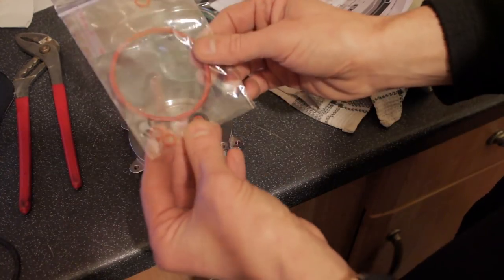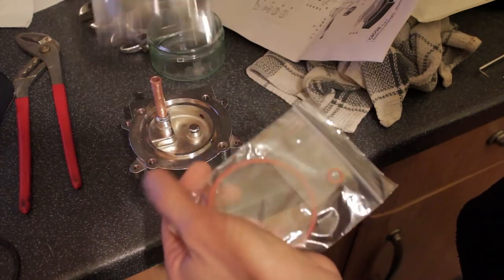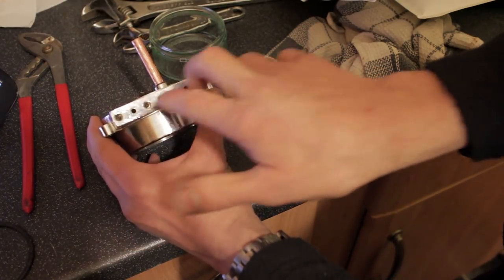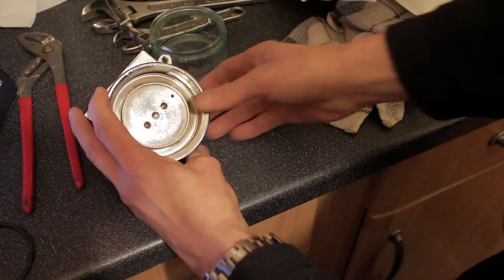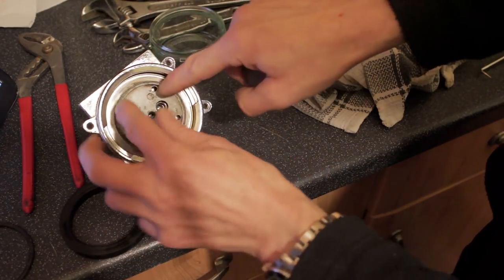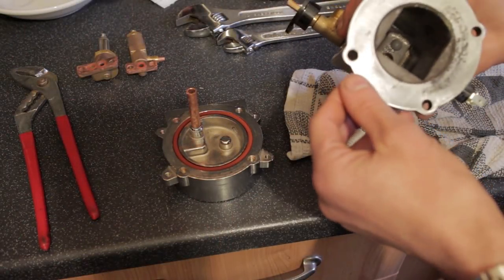So I'm going to use the replacement gasket - this red one here. This is a rebuild set which cost about five pounds, and this is a group gasket costing about three pounds fifty. These are consumables that you'll need to replace every so often. The back of the group shows where your two O-rings sit, and where the three-way solenoid valve and over-pressure valve fit. To give you a quick overview: you've got your group gasket, your portafilter gasket, and this thermoblock disperser which disperses water around the whole thing, then your shower screen sits there.